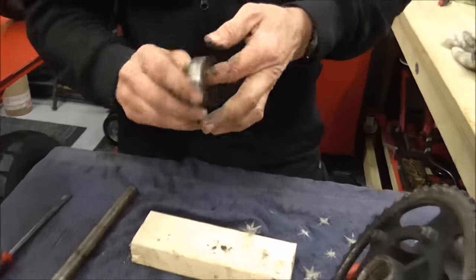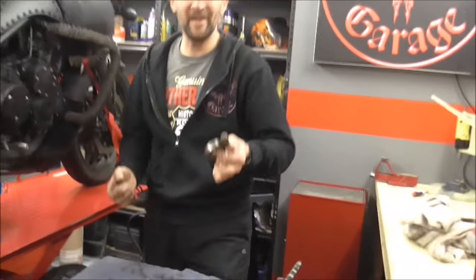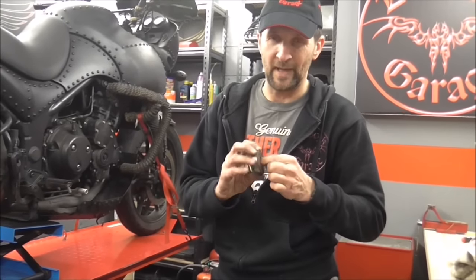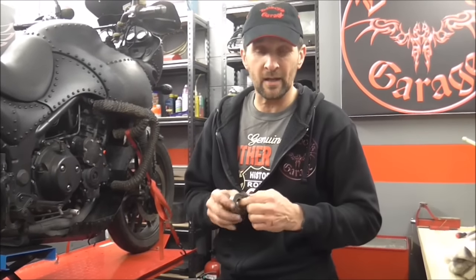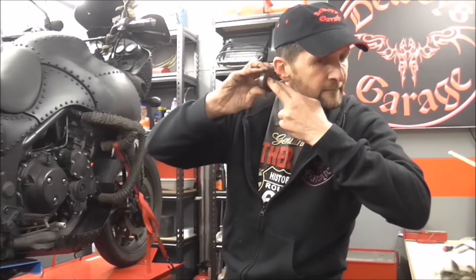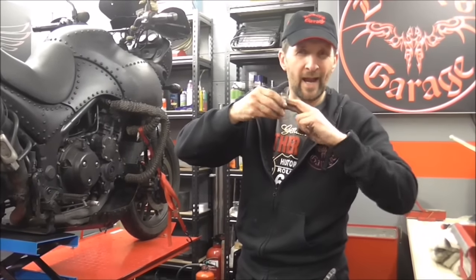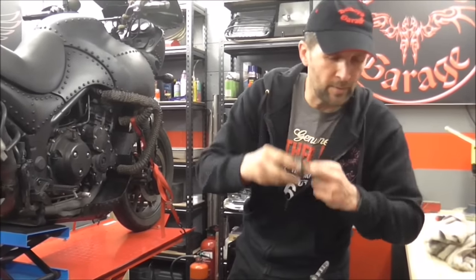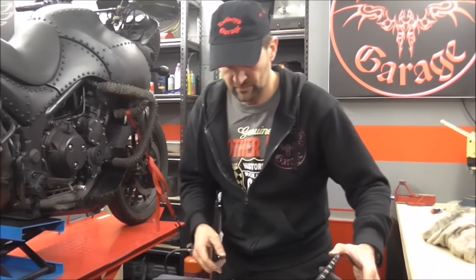Can you smell that? That's stale grease - that sulfurous smell of bearing grease when it's just been released. It kind of smells like differential oil. That bearing, when you move it around, you can hear it making a noise because the rollers inside - the little round cylinders - are all chewed up with grime and corrosion. That's the problem, which is why they're gradually going out. This is also why you wouldn't replace just one - there's nothing wrong with the other visually, there's no play in it, but it's also aged. So that's now ready for replacement.